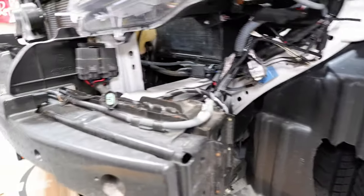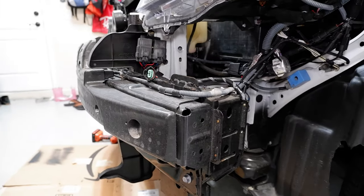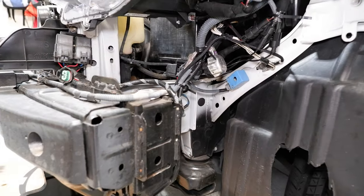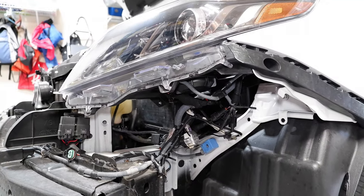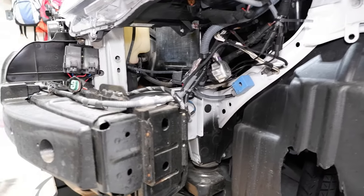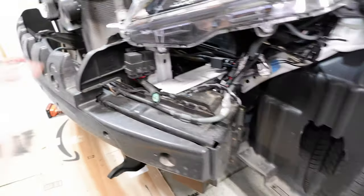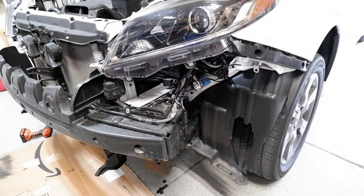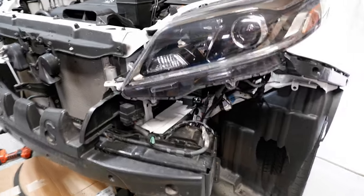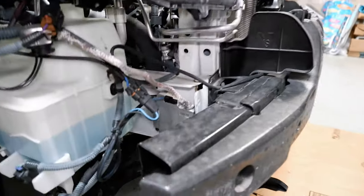As far as my HID setup goes, I originally set these up with my Denso ballast — I've got a ballast here and one on the other side. I'm actually running the D4S setup right now that I took out of my IS when I did that retrofit. I originally ran the D2S on this with some Morimoto bulbs, but I ended up using my D4S CBIs from the IS since I already had them and I used that ballast. These ballasts are actually potted and water resistant for this application. I mounted it right on the frame rail on this side. I'm using the Morimoto relay system because the circuit on the Sienna wouldn't fire these OEM Denso ballasts — they were drawing too much current on initial startup and wouldn't come on unless I turned the lights off and back on again. That's why I had to use that relay.